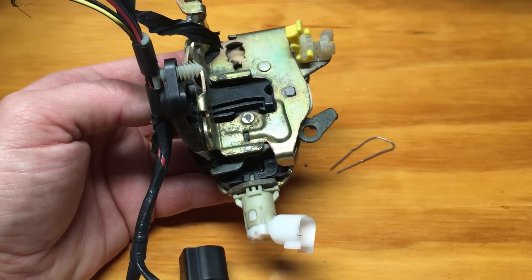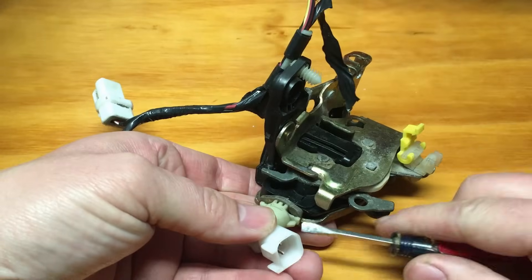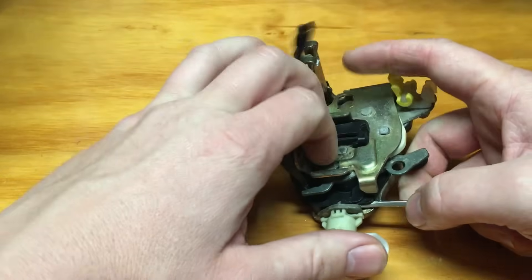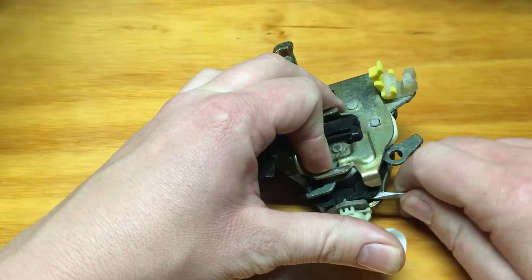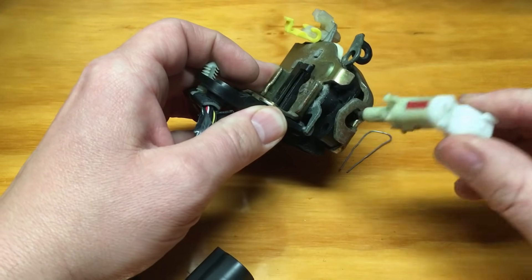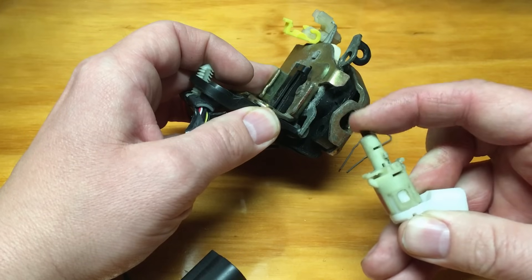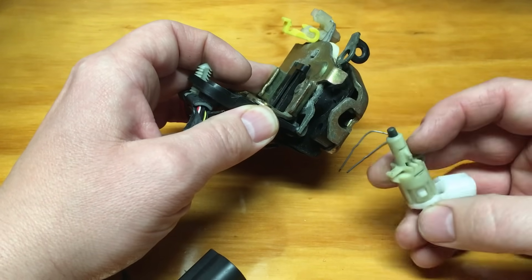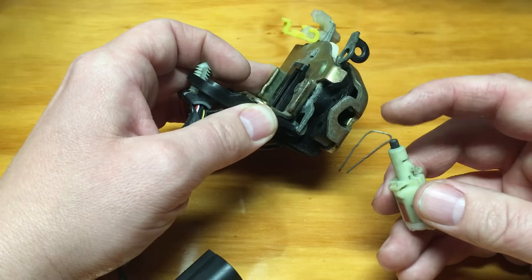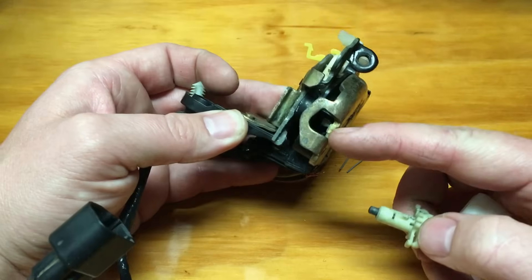Once it's out on the bench, you'll see it says 'tab' right there — you need to lift that locking tab up. Lift it enough and then turn it clockwise, and it comes right out. You can see that metal shaft — the pintle — that's what gets stuck. Some have a different design, like an orange one with a ball tip, and those ones really get stuck a lot.